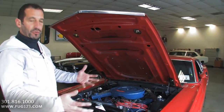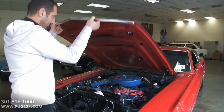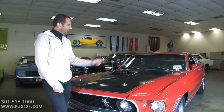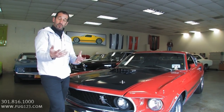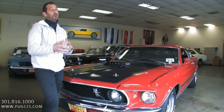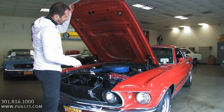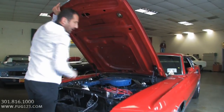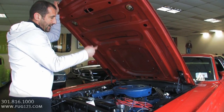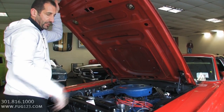We can kind of hide some of those things if you really wanted — move them to a couple other places and nobody would ever see them. Let us know if you want to do that. Some people love the look because it really screams high-performance. Made sure the horns work, the turn signals work, the marker lights and parking lights work. Just really nicely done under here. This car could easily have a shaker hood in it if you wanted to — it didn't come from the factory that way. But the shaker hood never really devalues the car; it always adds value and always looks great. These cars come already ready for it — it's already cut out from the factory, and it comes with a trim plate kit. Get the all-new air cleaner that goes on there with the shaker, trim ring goes around where you made the cut, and it's really done. We can do that here or get it done when you get the car.